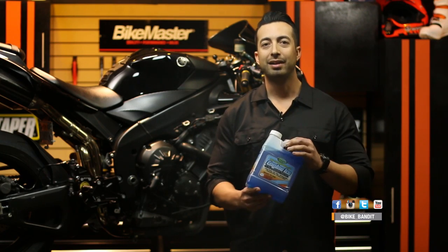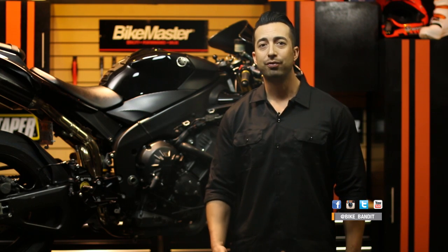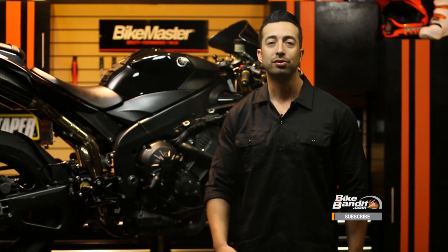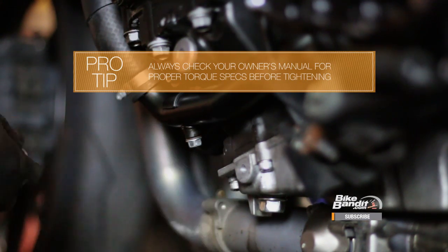What I'm going to be using today is Engine Ice. Engine Ice is a great all-around product — it helps your engine run 10 to 20 degrees cooler, provides antifreeze protection all the way down to negative 26 degrees, and it's pre-mixed so it's easy to use. It's even biodegradable and non-toxic, so it's safe to have around pets and people. Since this is the last time we'll be filling the cooling system, it's time to fasten the drain plug for the long haul. This is where we'll go ahead and install the new crush washer if we got one and torque the bolt to spec.